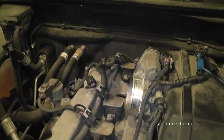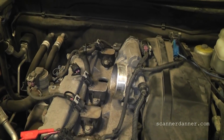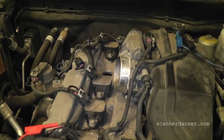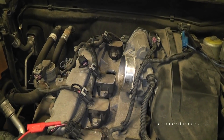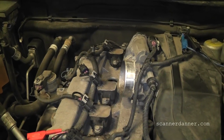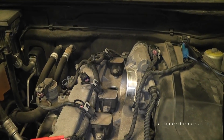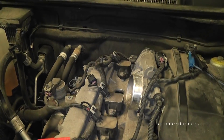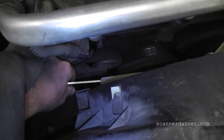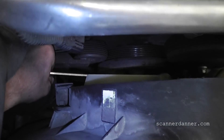The idea here is that with the valves closed, the last time we did this we weren't worried too much about being exactly at TDC — as long as we're on the compression stroke with valves closed, it really doesn't matter. Some people think it does, so let's do it this way too, just to be 100%. We'll show the leak down at TDC and then pull the piston back down earlier in the compression stroke and do the same test to show the difference.